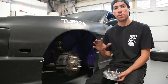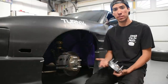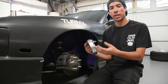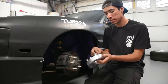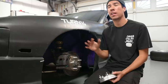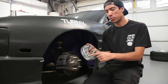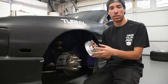If you're looking to purchase spacers, make sure they are hub centric unless they're 4mm or less slip-on type spacers. Another thing to look out for is stud and nut quality — try to get spacers with high quality nuts and studs to prevent stripping or breaking. These are my older 15mm spacers with very cheap nuts and studs; I almost cross-threaded them a few times and they felt like they were about to strip. You can also buy cheap spacers and press out the studs and press in new OEM-quality studs for peace of mind.